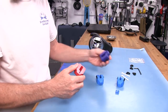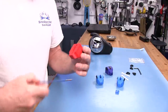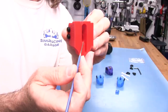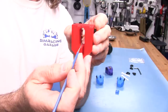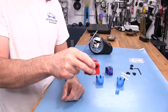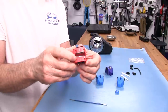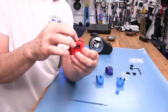Inside of these — the red will show better — there are ball bearings, the metal plates, and some indentations on the sides. You can see two raised areas with a groove in the middle on each side. The purpose of that is to act as a guide so that when we're sliding it down the shifter shaft, it guides it properly and doesn't cause any scratching. It also helps keep everything centered while in the center position.